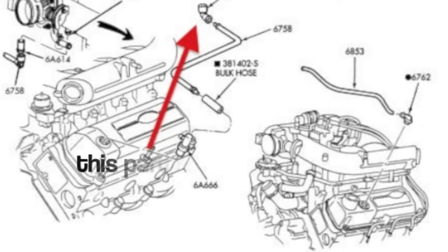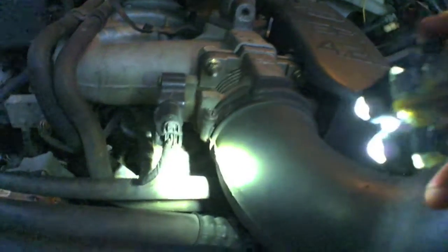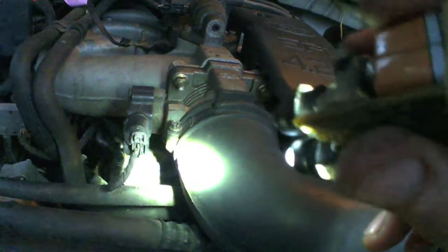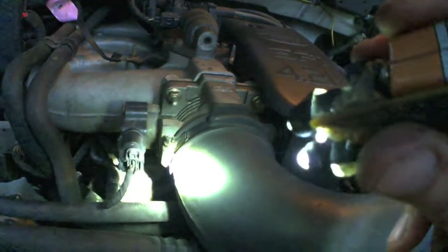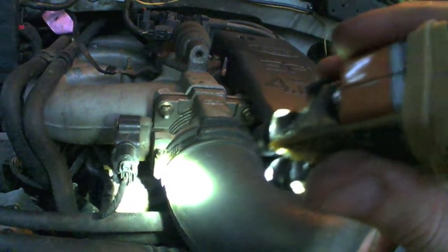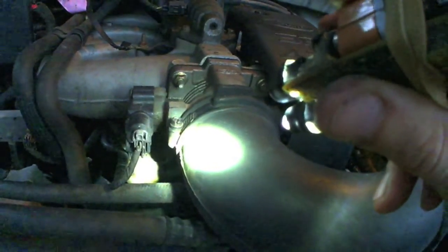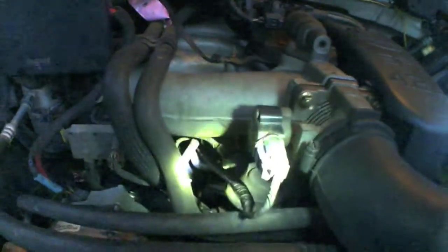It's super difficult to get to. I had not one but two of those things go bad on me. After fixing the first one, I didn't really notice that the second one was bad until I opened it up today to put some oil in and heard that hissing noise again. It's pretty distinctive — you shouldn't hear anything but rocker and valve noises when this thing runs, besides the fan obviously.